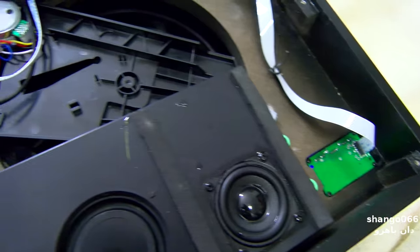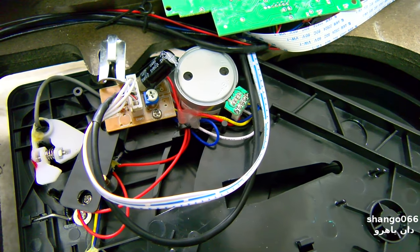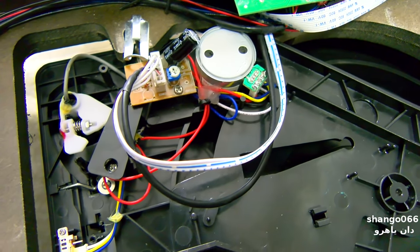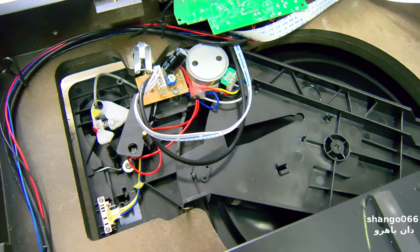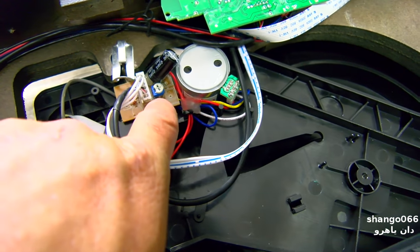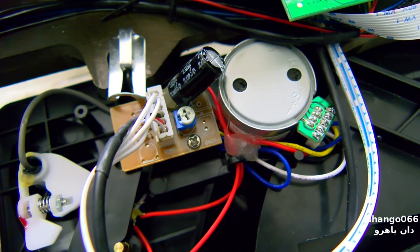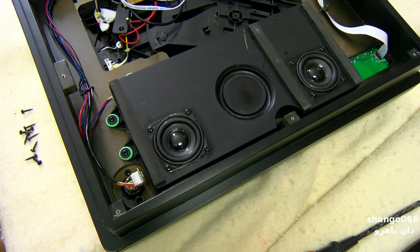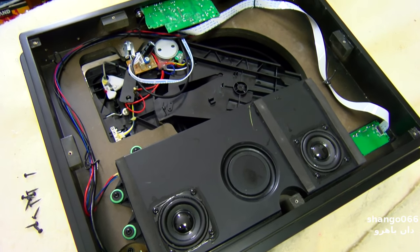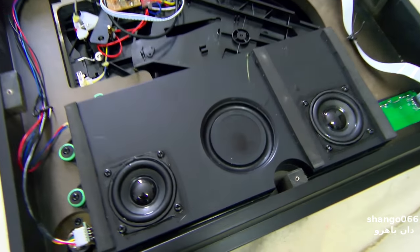The turntable drive is kind of like other drives that we've seen for the Crosley. It's got what looks like a tape recorder DC motor with a large bypass capacitor on it. And I'm going to assume that this might be the speed adjustment right there. Probably. The audio leads for the tone arm for the cartridge are also brought into that black cable on the same connector as the motor power.